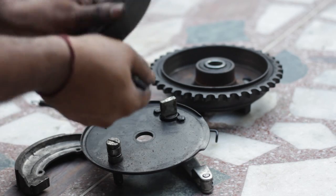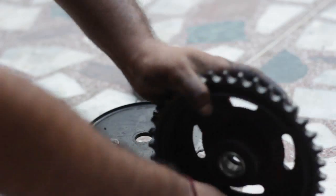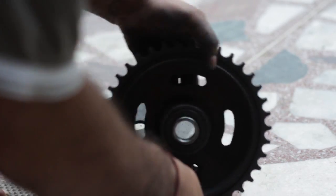For maintenance, scrub both brake shoe leather surfaces with coarse sandpaper. Also scrub the inside portion of the drum brake with the sandpaper. You can do this whenever you feel your brakes are getting squishy but you find there is still enough leather material on the brake shoe.